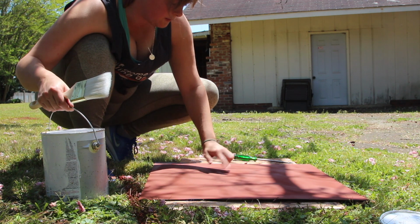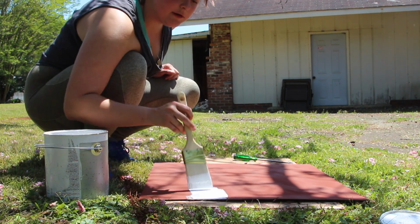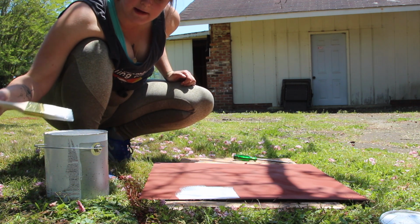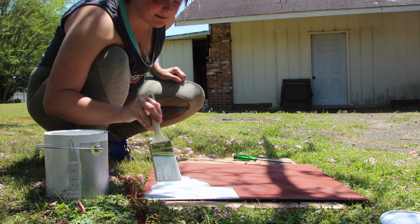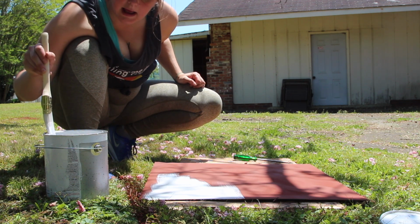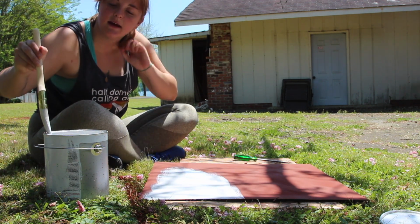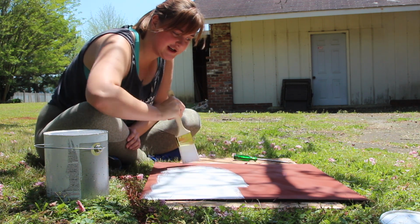The reason that we are covering up that emergency hatch hole, we have to convert it to a 14 by 14 inch hole, which is kind of standard for RV roof vents and fans and ceiling things. But the current hole is like 22 by 22, so we have to cover it up and then cut a new hole in this piece of metal. What we are putting in the new hole is an air conditioning unit.